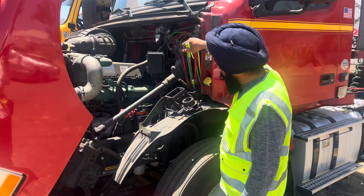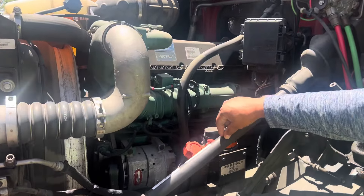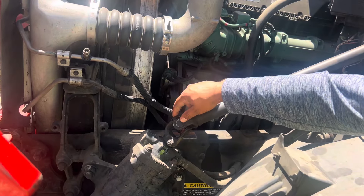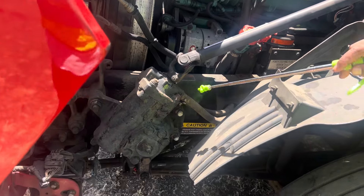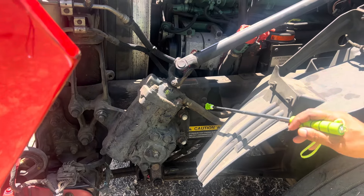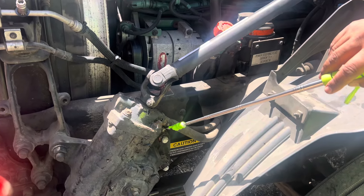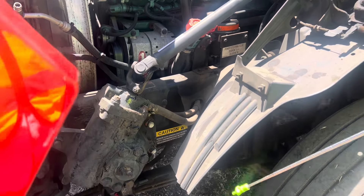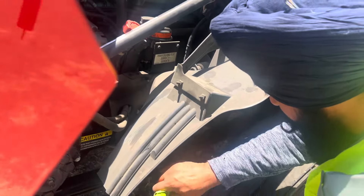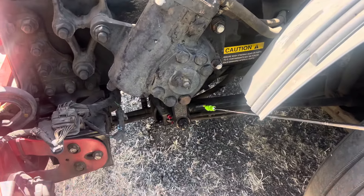Airlines securely mounted, not cracked, no leakage, not bulging, and well routed. Steering column: not cracked, not bent, no play more than 10 degrees. Universal joints both sides well lubricated. Power steering gear box securely mounted with the frame, nut bolts tight, not cracked, not broken, no leakage. Power steering hoses securely mounted both sides, not cracked, no leakage, not bulging, clamps tight. Pitman arm, drag link, steering arm, and tie rod securely mounted with the castle nut — all cotter pins in place, all joints well lubricated.